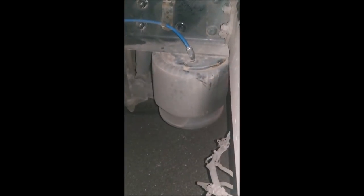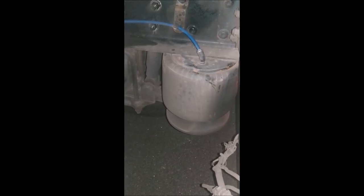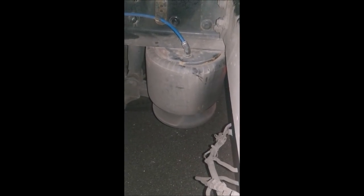Edited to add this in. I've deflated the airbags — as you can see, they're deflated and nice and soft. I disconnected the airline so I can show you this actually works. I'm going to reconnect it and supply the air and release the brakes. I'm going to air up the airbags — see them inflating. Starting to inflate. And there they go — airbags are inflating. Makes for a nice easy tow.